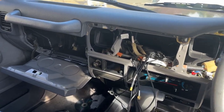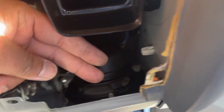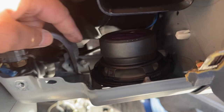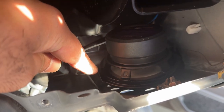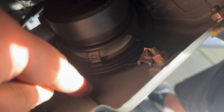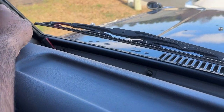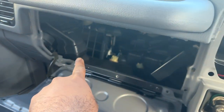As you can see, I have the entire dash apart. In order to get this speaker out — it was not an easy job. Best thing to do is take the cluster out, then you can just put your hands in, get it out, and there's one screw at the bottom. I just folded these little ears and used one on the top, so these are made-up little brackets I had laying around — just bend it, screw that right there, and bolt it on. The GPS antenna hasn't been glued down yet — I ran all the wires right behind and tucked them up top.